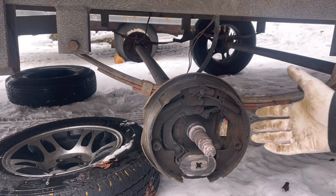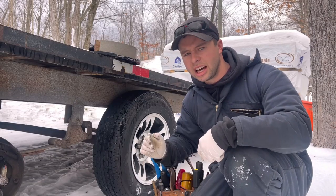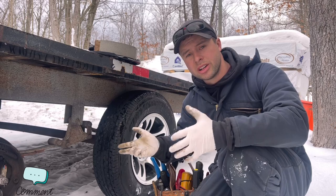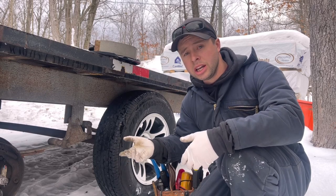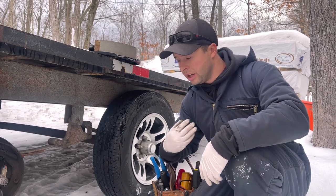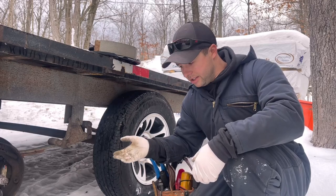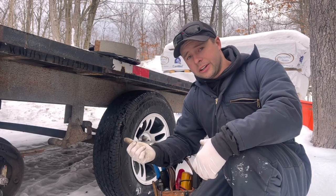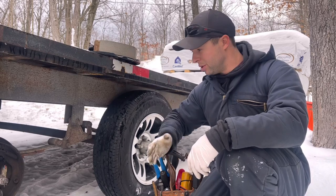Apparently once those wear indicators are worn off you're supposed to change out that magnet. Ours are way too far gone and that's why our trailer brakes were starting to get weak. So we're going to go ahead and replace this stuff — you can tune into the channel for the next video on that. But this is how trailer brakes work, not for dummies, just for anybody that doesn't know what's going on in there. Thanks for watching — I just thought I'd make this video to show you what's going on inside trailer brakes. If you haven't taken one apart or done your research, you just don't know. Nobody knows everything. I've been a mechanic for almost 10 years and I'm just getting into these.